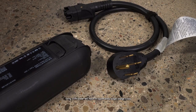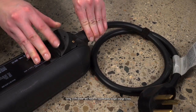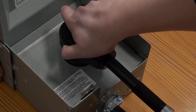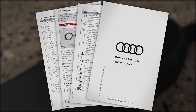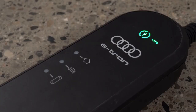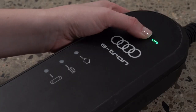On the control unit, connect the appropriate power cable for the available socket — household or industrial — and close the lock. Plug the power cable into a dedicated outlet. The icons on the control unit may glow or flash green, yellow, or red depending on conditions; see the owner's manual for details. The control unit automatically recognizes the voltage and available current strength. The charging power level can be set to full or half power by pressing the power button for three seconds.